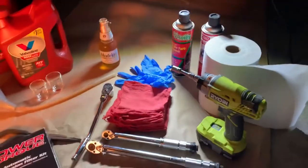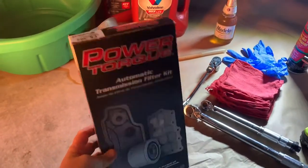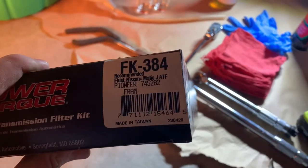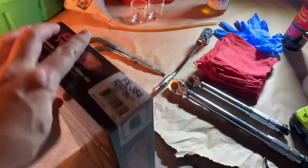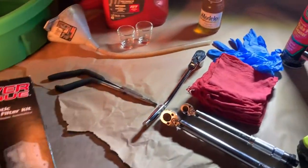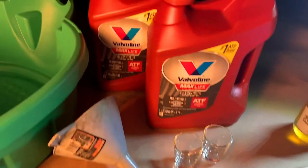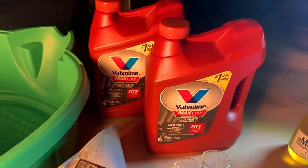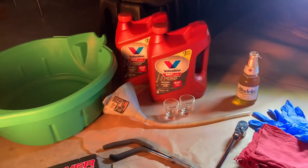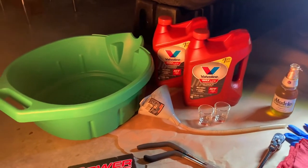So we're going to go over what I'm going to be using here. First off, I've got the new filter — a filter screen kind of deal. I got this at O'Reilly's. The part number is FK384, and this is from PowerTorque. I also got Valvoline MaxLife ATF full synthetic. This was recommended — Amsoil is really good too. There's a sticker in the engine bay saying not to use anything but Nissan fluids, but that's already been debunked, so just do your due diligence.